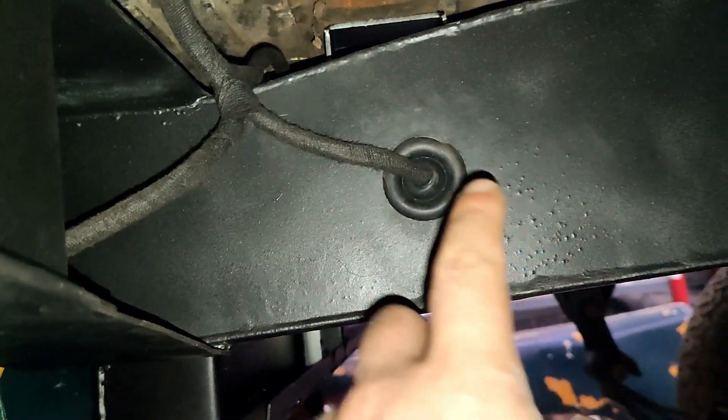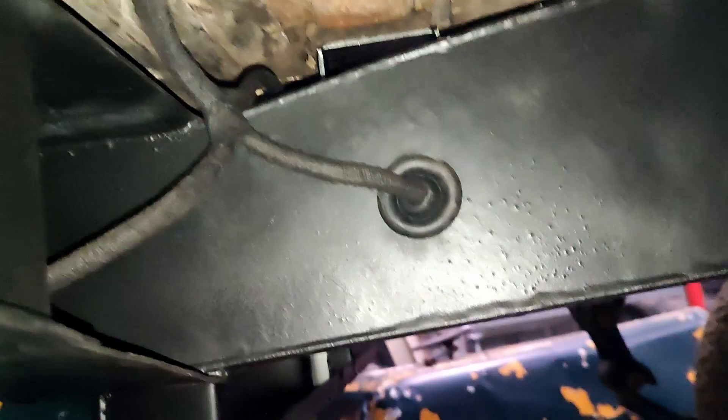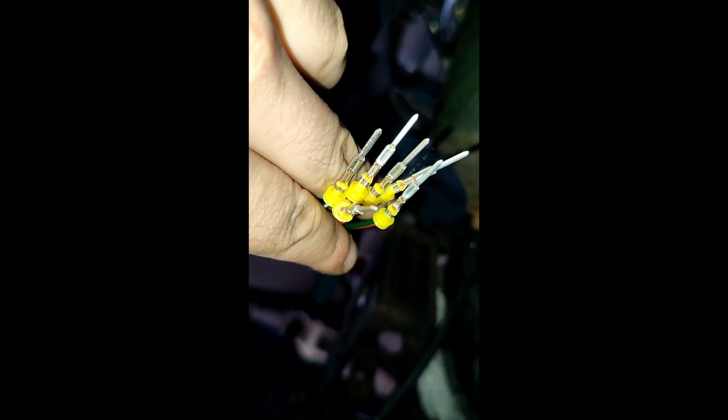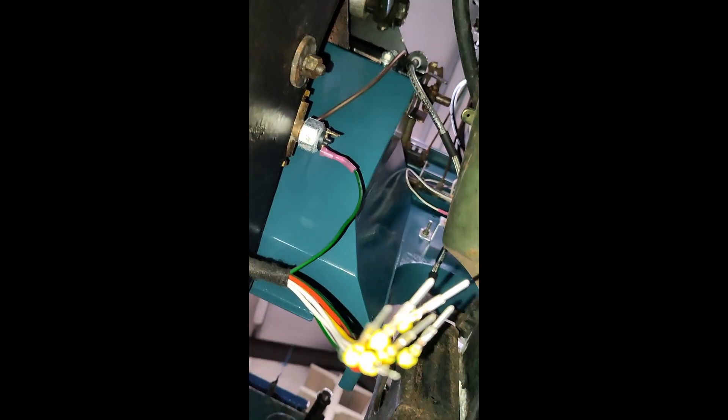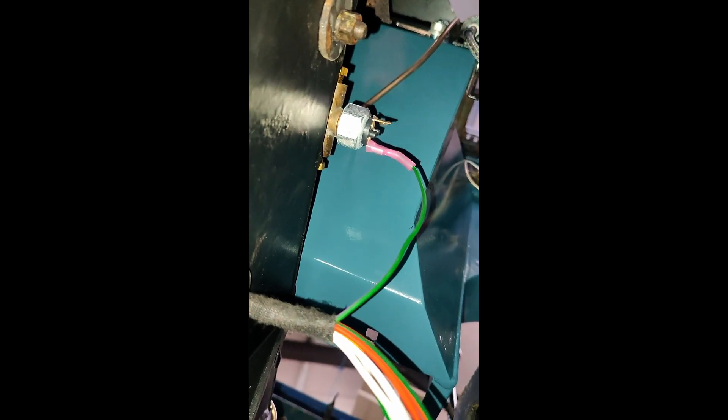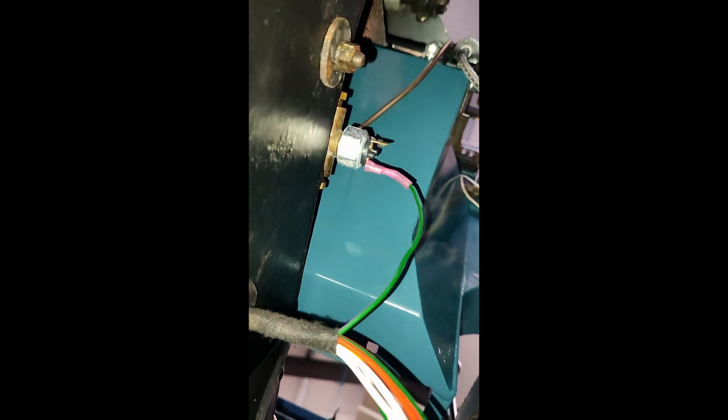Tow bar electrics is coming out there, and stepping underneath the vehicle — that there's our harness coming out of the chassis down to the tow bar, up onto the off side, and then the other branch over there going onto the near side. Looking up, this is the other end of that wire — I've got all these crimped on, ready to go into our waterproof connector. That wire goes up onto our brake switch. You need the proper crimping tool to do these, but they're not too hard. And these spade connectors — female, with heat shrink on them — give more bite on the cable and protection from the elements. Before sliding them on, I like to put a bit of Vaseline on all the connectors to help prevent corrosion and help them come off later.